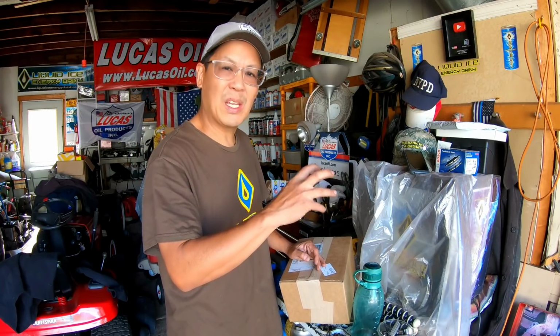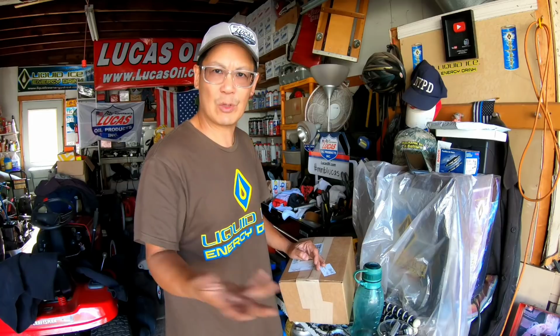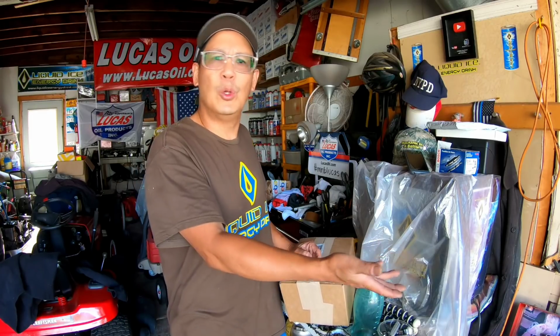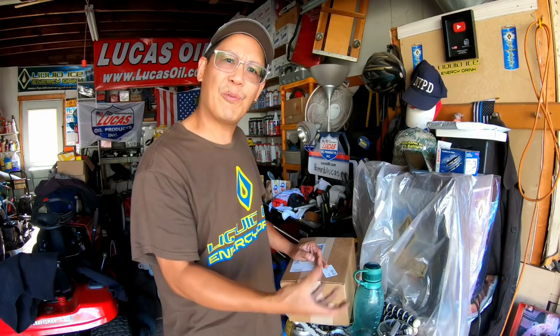So the complaint was that because it's only one tab on the top, overuse and wear make it pop off while you're mowing, and then it gets stuck underneath and you shred it. That's why a lot of people are missing them. So I contacted Kohler. I said, hey, you can't even find that cover anymore. How am I supposed to cover up my air filter if you don't make them anymore? He said, you've got to get the kit that converts it to four tabs, two on the top, two on the bottom. I said, but then don't I have to buy the air filter base? He said, yeah, you have to buy that too. I said, people who bought that Toro didn't sign up for that. That's your fault for designing that cover badly. He said, I suppose. Anyway, I didn't hear anything from him for about a week.